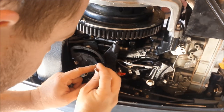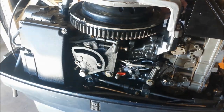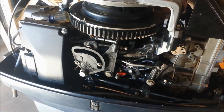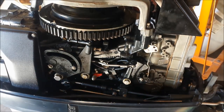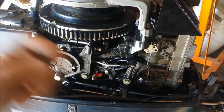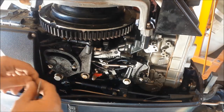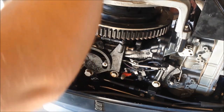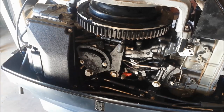Now in this model the roller is held in with a little rubber o-ring. I got a spare just in case I needed it, and using a razor blade to get it off I probably will need it. The little ring is off — take off the washer, and we'll be able to slide the roller out, or at least what's left in my case. Let's slide our new one in. It came with a new washer, might as well put that in. Pretty new washer is on, and we just put on our o-ring and we're good. There's one — tightened up the ignition quite a bit already. Now we'll go ahead and do the front.